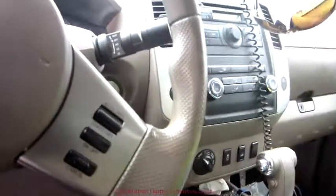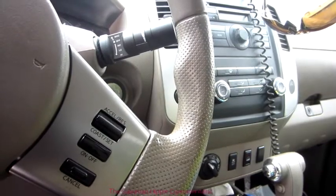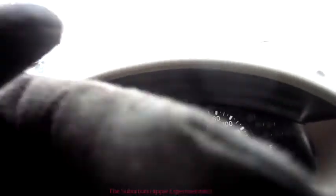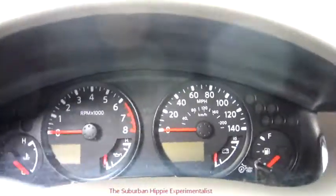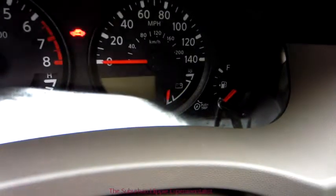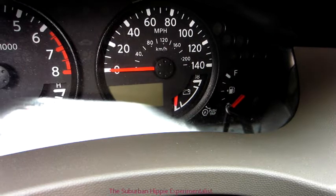I did route the sensor cable, but before I fit those rubber boots into the brackets, I want to start the car up because there's a little self-test it does when you first start the vehicle. I want to see if that light goes out — it may be as simple as looking for opens. I want to start it up anyway before I go to the trouble of pushing those rubber grommets into the brackets.